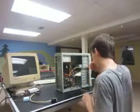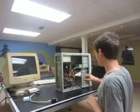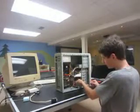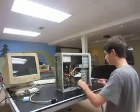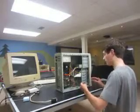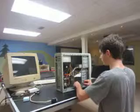So now we have our drives connected to our motherboard, power to the drives and the motherboard. We still want to connect our case to the motherboard. This will be right where we connected the speaker before and the power switch. You're going to find more, similar cables, that will provide light for the front of your case, or connect the power button and the reset switch. So just take those and connect them.